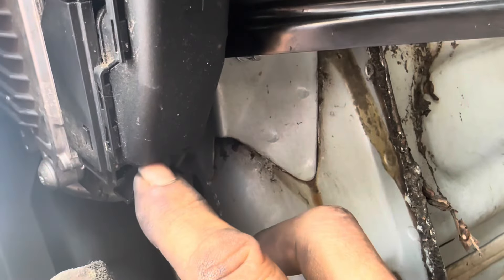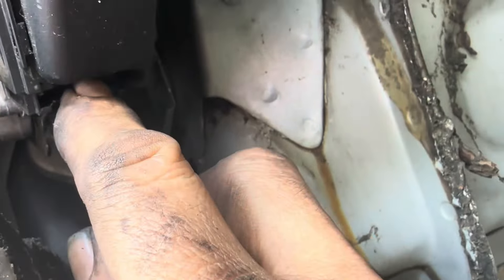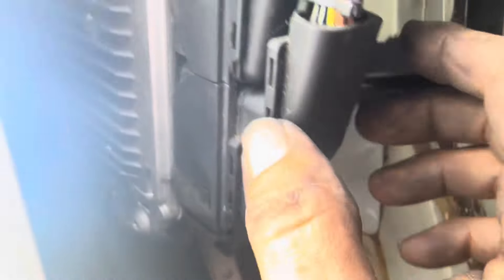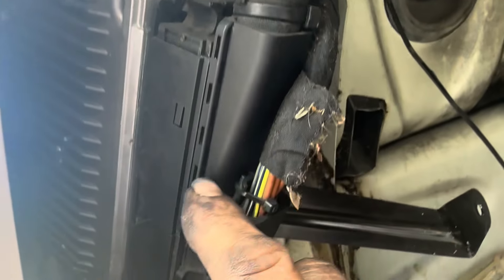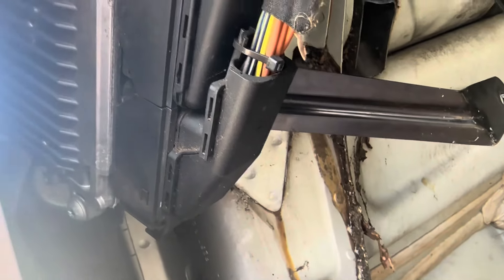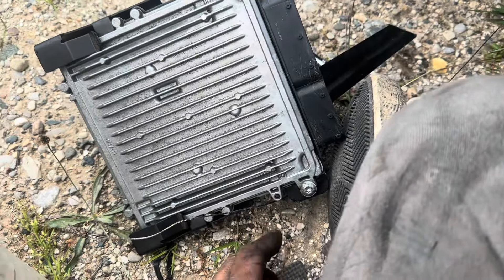Being fickle means you need to pull that back a hair, then you can stick a screwdriver in there, and with your other hand pull it away. Be very gentle with the screwdriver — we do not want to break these cam locks, as you will have all sorts of problems. Then you would just remove this one Torx if you need to take the ECM off the tray.